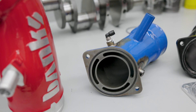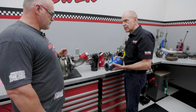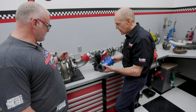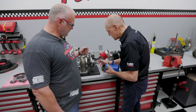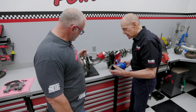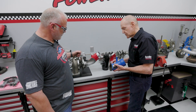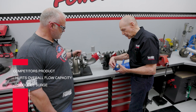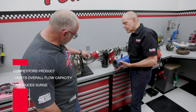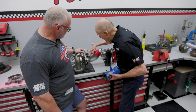So what's out there on the market? This one's an interesting one — this guy obviously used bent muffler tubing, a steel tin deal. But he made his flange kind of weird. The outlet flange bolts on and completely eliminates the surge gap — it just bolts directly against the compressor inlet. There's nothing going on here that's positive; it's all negative. This thing hurts overall flow capacity by having material hanging into the inlet area, and secondly, it makes surge like a bandit. It opens that gap that's pretty critical — kind of eliminates it, leaves it wide open.